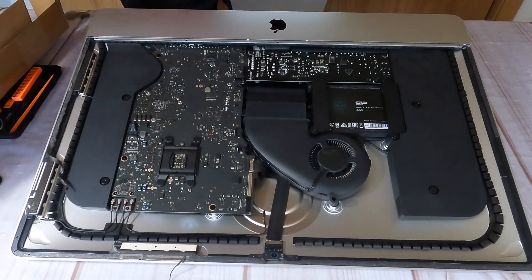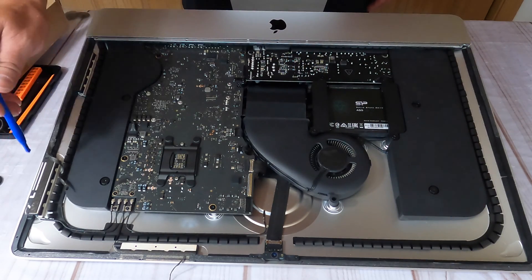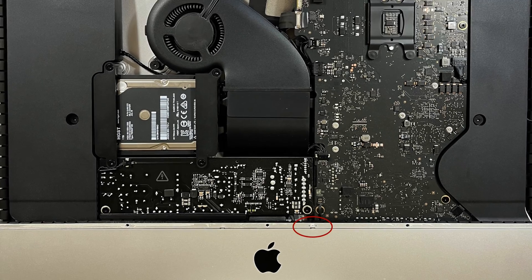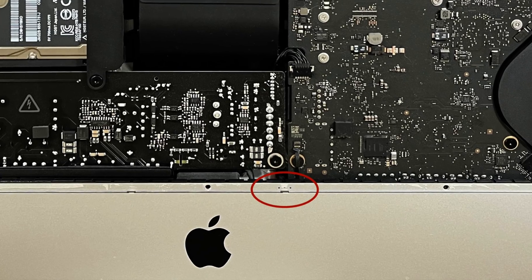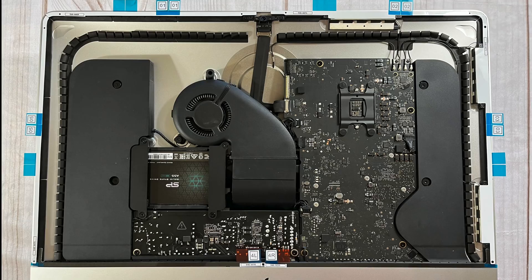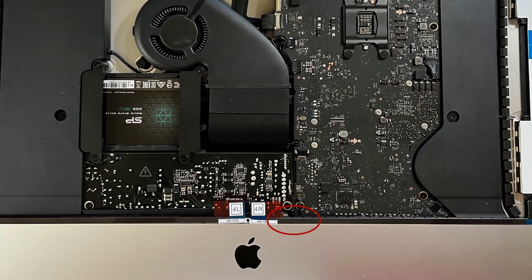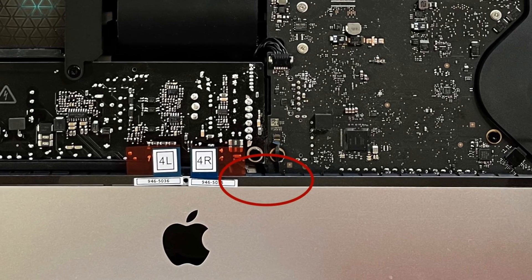My next step is I'm just gonna go ahead and clean off the rest of this tape, and then clean off any tape on the display. Look closely here — down here at the bottom, just to the right of the Apple logo, is the microphone for this device. Be sure to research the location of your microphone. When you adhere the tape, look closely — this is where the microphone should be, but the tape covers it up. You will need to remove a small portion of the adhesive tape here so the microphone is available.